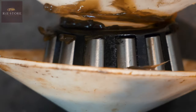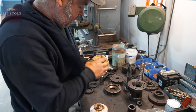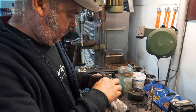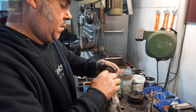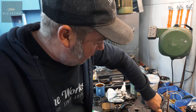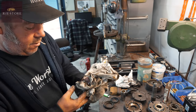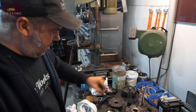Your bearing's packed then — lovely, it's got grease in it now. That's the proper way to pack them. Obviously that's got nowhere near as much as that in it, but it runs in oil anyway, so as long as it's got some lube in it. Then you throw this cloth away because every time you pick it up you get covered in grease. So we've got our bottom bearing in.